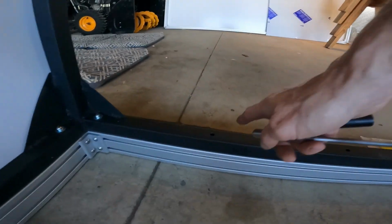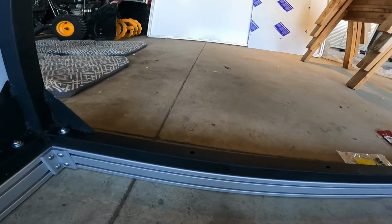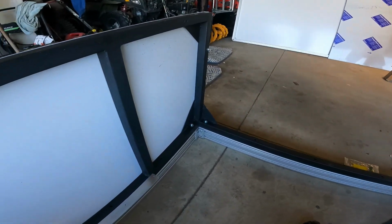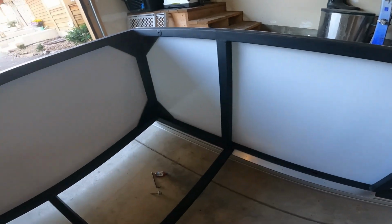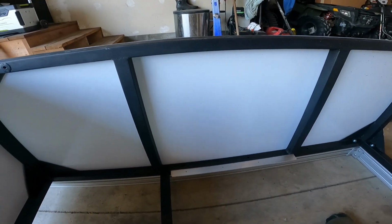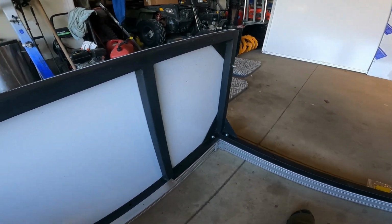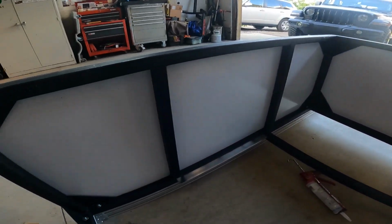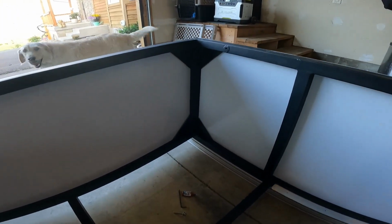I think the key was drilling these on the drill press before I welded them into place so that the holes were perpendicular, and drilling them oversized. They're 3/8 holes for 5/16 fasteners. And then siliconing those T-nuts into place so they don't get jostled around while we flipped the space frame upside down on top of it. Hopefully it'll continue to go that smoothly.